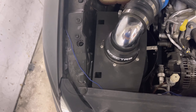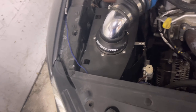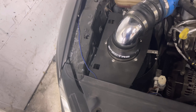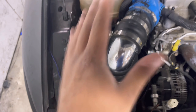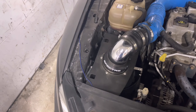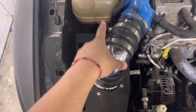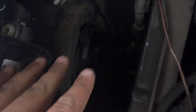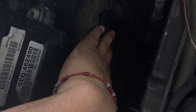If you actually look at the instructions, there's a lot more information - it seems more in tune for the Dart because I don't remember ever having to take a bolt off here for the stock air box. But it's still doable - I know a couple of 200 guys with this engine setup, so I know it's going to work. So I'm going to get this setup out and come back to you. Now the air box is removed. Here's our little air shroud - that's ultimately where our new air box is going to be going in. We are at figure 10 in the instructions and we're going to have to take off our front bumper.